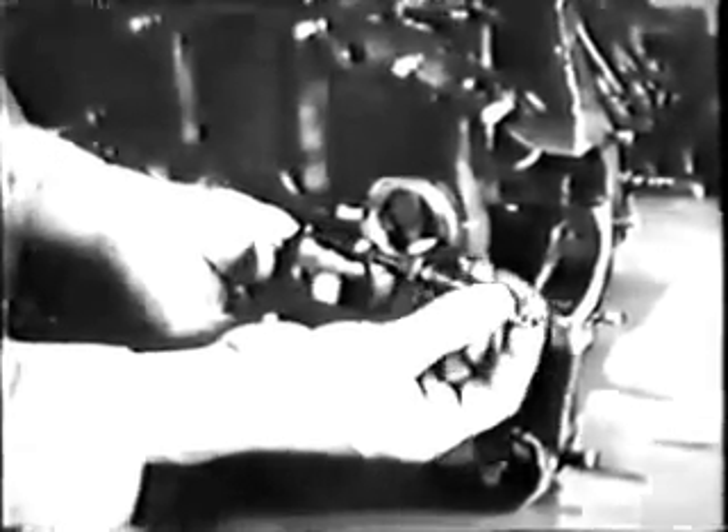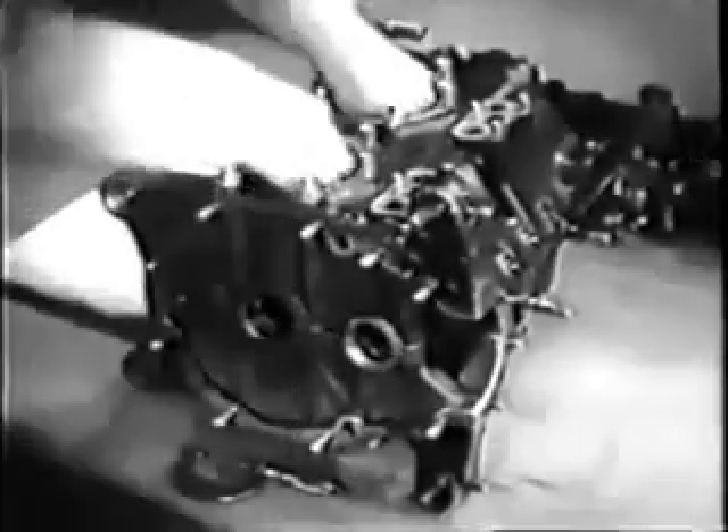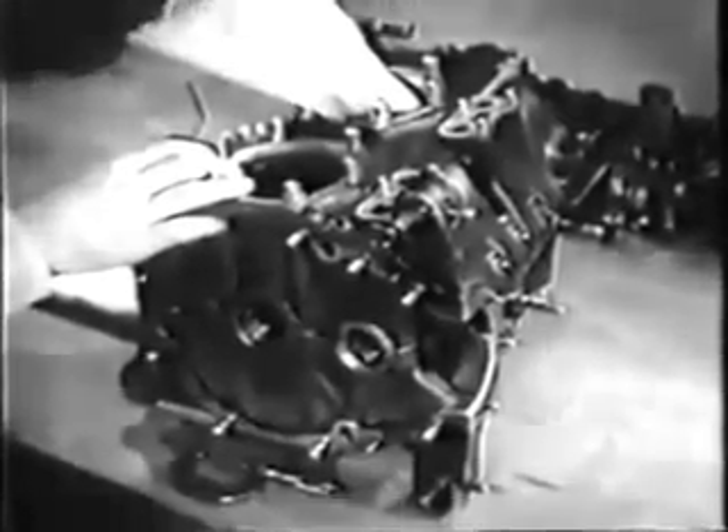Now you'll have to take readings of the three camshaft bearings in the crankcase. This is the rear one. Again, if there's a variation, take the larger reading. With this reading, you figure the clearance with the camshaft by subtracting. Your result should be checked against the table of limits. The center and front bearing measurements for the camshaft will have to be taken by reaching through the cylinder port — they must be taken, and the clearance checked for each one.